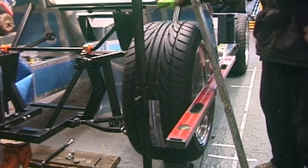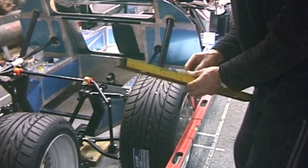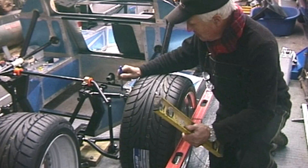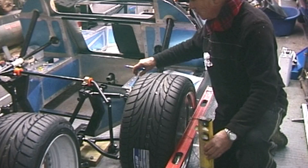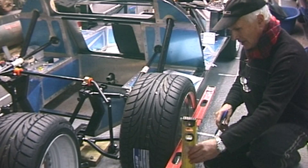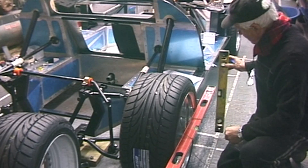I measure the distance it's moved on the floor. I set the rear uprights to seven degrees leaning back — that wasn't very good, because the links wouldn't screw properly onto the rose joints, so I've also got a fair amount of bump steer. The bump steer's measured by showing how much the wheel goes in and out as it's raised up and down.